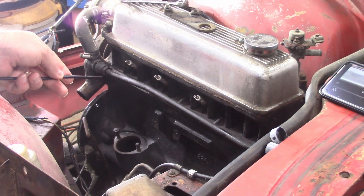First we'll look at the number four spark plug hole. You can see the cylinder wall there, and there's actually some crosshatch — so that's cool. I don't know if that's a good thing or a bad thing. Just barely see the top of the piston there. You can see what look like pits, but I think they're carbon deposits, not actual pits. See the line where the piston is at top dead center? Some corrosion, but it doesn't look horrible.